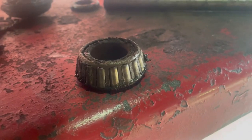It definitely weren't loose. I think it's just worn. So that's the idler bearing out and everything. They've got it all in stock, so we're gonna put a new bearing, grease, new nut, new spacer washer, and then this obviously comes with two nuts. So hopefully that'll do it and fix it. I don't really want to leave it.